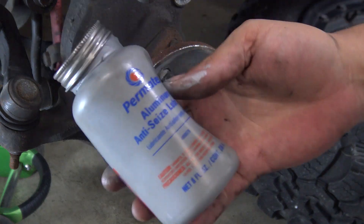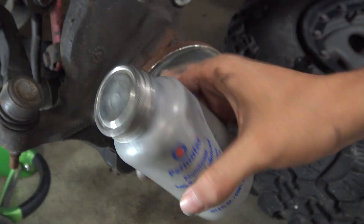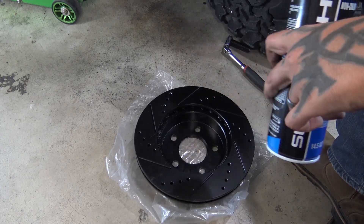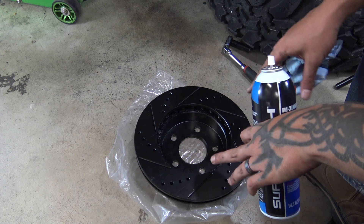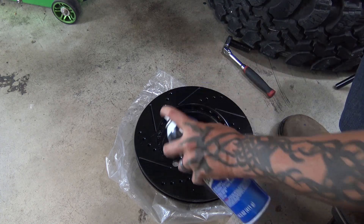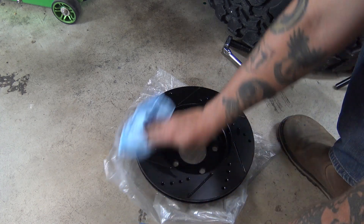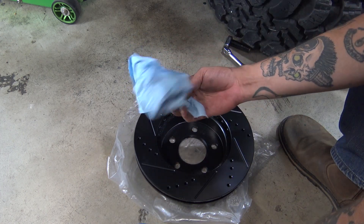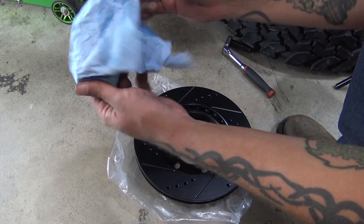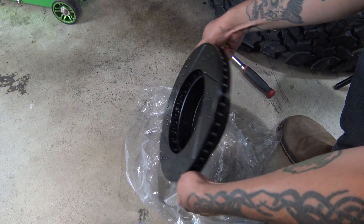Since there's already some anti-seize on there — and I know there are some die-hard people that insist on only using anti-seize — what I like to do is clean the back side of the rotor before I put it on, and then once I have it on there, clean the front side. So you still have the front that you can handle. The only thing you have to try to worry about is not handling the rear. And that's really all you need to do when you clean your rotors. With standard rotors you'll actually see the oil they put on there, but this came out fairly clean.